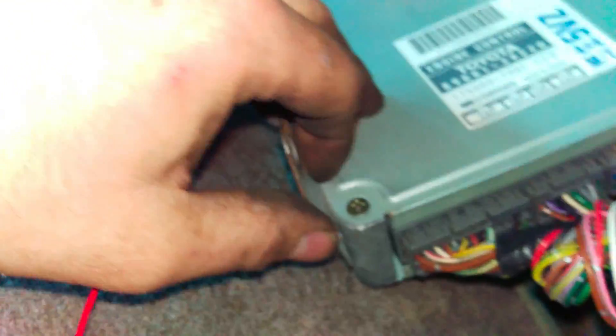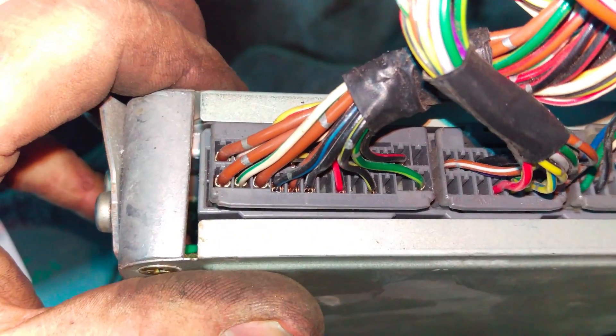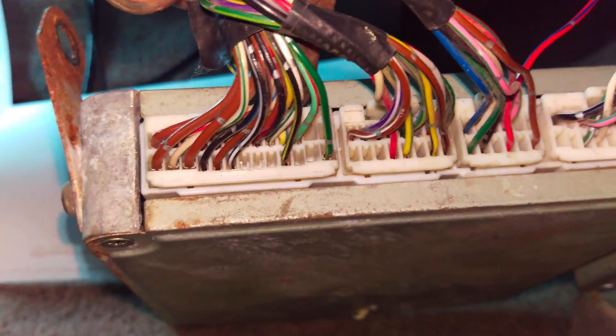The other one — the FPU VSV — that's 19D, not 9 like I said before. You can see it right there, that red/black right in the middle. And on the 97 ECU it just doesn't exist; it doesn't use it.